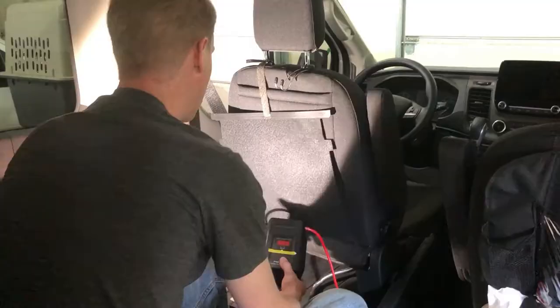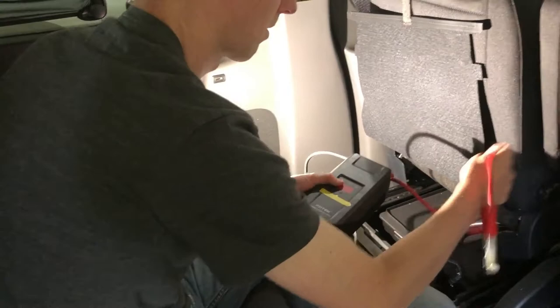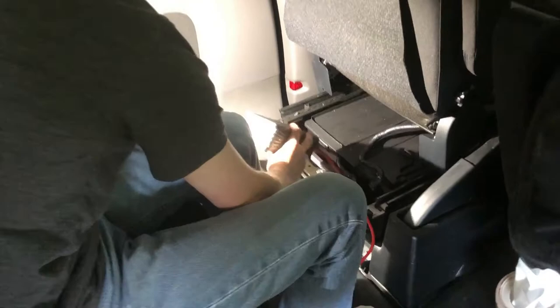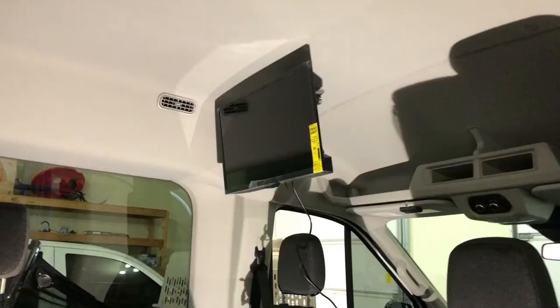It's a 750-watt inverter. I did cut off the alligator clips and installed some direct bolt-on ear tabs. It has plenty of power. I do turn it on and off each time I use it — I just reach under the seat, which has a little drape that covers over it, and turn it on and off before I use it.